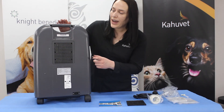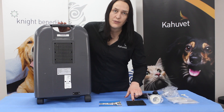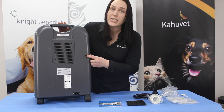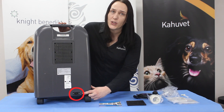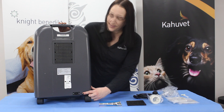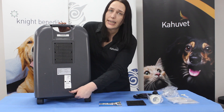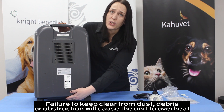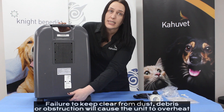To the back of our unit we will find the cover plate for our filter housing. Behind this cover plate we will find our dust filter first, and a little bit further back will be the HEPA filter. We'll chat through replacement of both these filters a little bit later on. Further down here we have the insert point for our power cord. It's also very important that we ensure the underside of the unit is clear of any dust or debris build-up, as the unit expels exhaust from the underside, so we want to regularly check that no dust or debris is building up to ensure the flow of the unit is left unaffected.